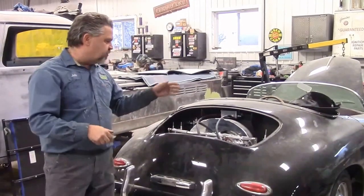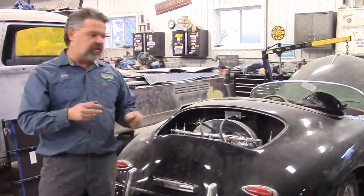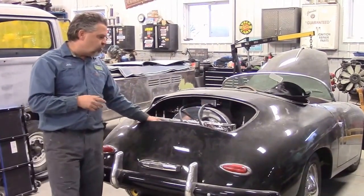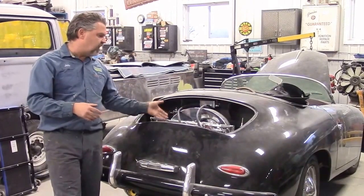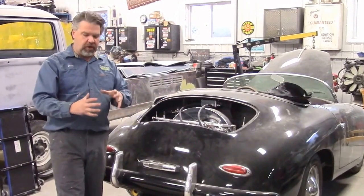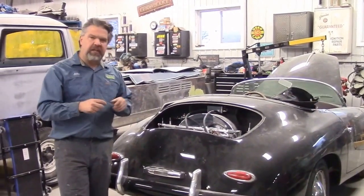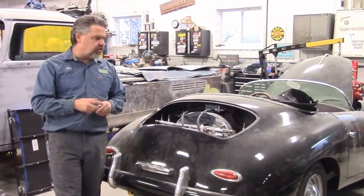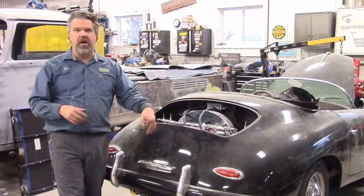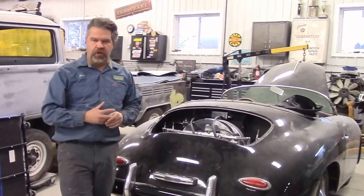It's just an exciting time for us because with the engine being built, placed in and broken in, we want to show the sound to our client. This is a 1957 Porsche kit car. The engine isn't crazy performance — we've taken a normal 1590cc engine, now 1641cc. We went with larger pistons and pots, a different camshaft with different lobes and gearing, tuned exhaust, and electronic ignition with a electronic distributor and dual carbs. It's just an overall happier engine and almost maintenance free in terms of overall drivability.